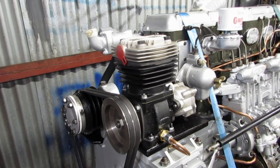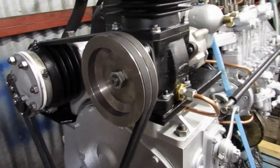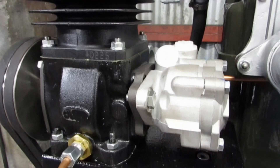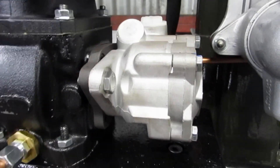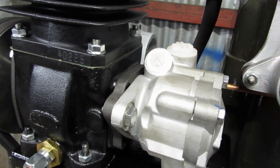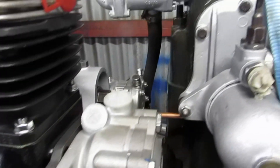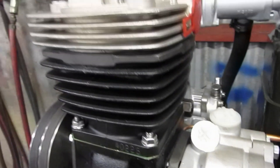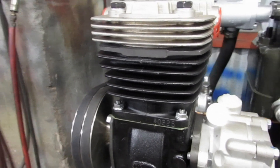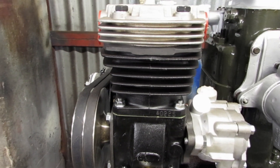The first thing I wanted to take you through is the compressor. This is a non-conventional compressor on a Gardner engine, and what's special about it is this hydraulic pump on the back here. You'll see that it has ports here for hydraulics in and out. This will be used for powering the steering on this vehicle. The pump is connected to this compressor here, which is a modern compressor off a Mercedes truck, and we've had great success with these — we've installed them in a number of buses in Zambia and they've really worked out very well.